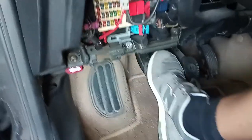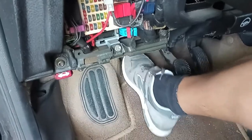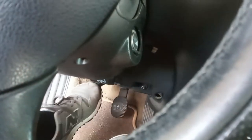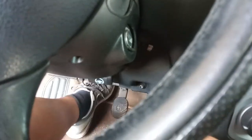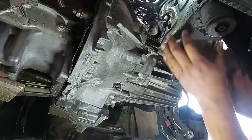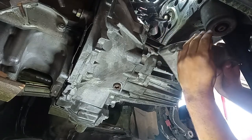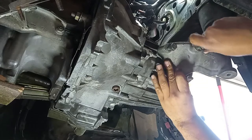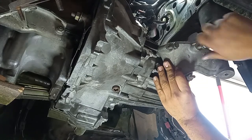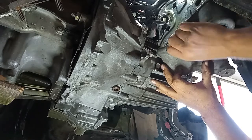The first time that you press, you can hear a click. That is the clutch assembly auto-correcting its position. It's very nice. Test a bunch of times to make sure it will not fail. It is also very, very smooth. Just the weight of my foot drives it down, so we can carry on. Before tightening all the nuts and bolts of the gearbox, I will put the powertrain assembly in position, to be able to apply a certain torque on the parts, and also in that way create more advancement on the work.